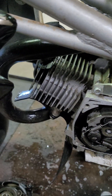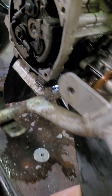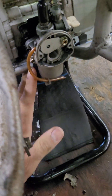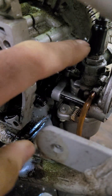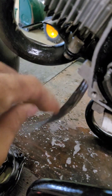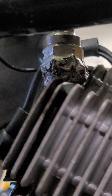To prep the bike for this test, because we want to pressurize the crankcase and the cylinder, we've blocked off the exhaust and the intake ports by using an inner tube. We just cut it into a long triangle so we can wedge it between the studs and make sure we block off the entire port. There's the excess sticking up through the top, and same thing on the exhaust. We've also made an adapter out of a spark plug and an air fitting.